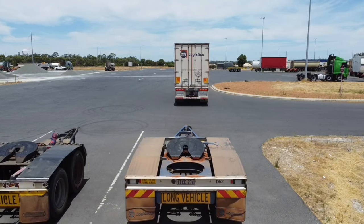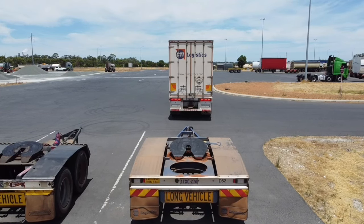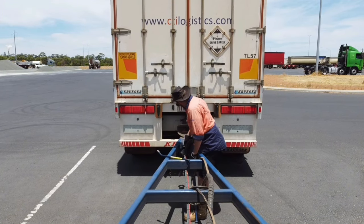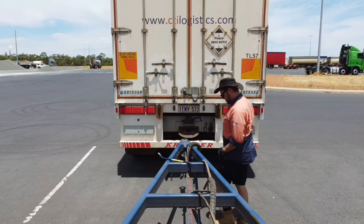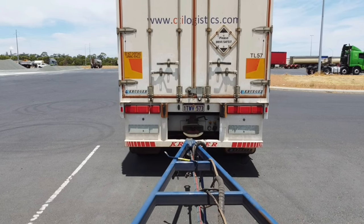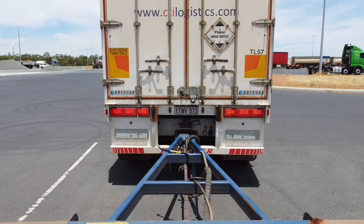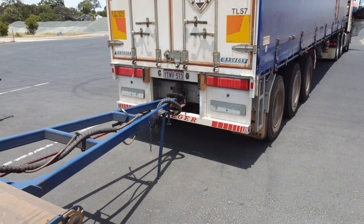Just get ourselves a nice straight line. This place has all the room in the world to back up so it's easy. I've got myself a nice little end bay and just take it steady, back up slowly. This is in fast forward because it's boring watching me creep back very slowly. When backing up I use the side of the trailer and the dolly mudguards to line myself up. Once I'm close I check the height and check the line, try to make sure I get it straight. I'm probably off a couple of inches but I'm confident I'm going to be able to swing that over with the metre or so that I have. Me trying to swing over and make that work — it's almost there. I backed up a little harder and might have actually got it, but I don't like to push them too hard, so I actually went back forward and had to take another bite.